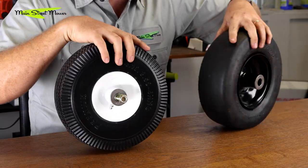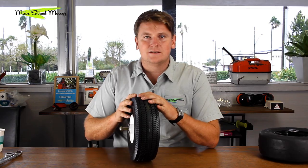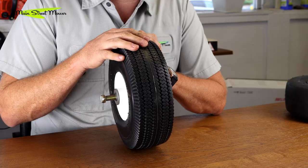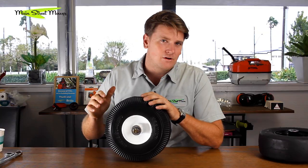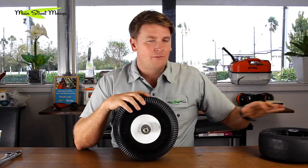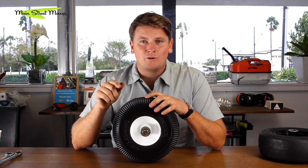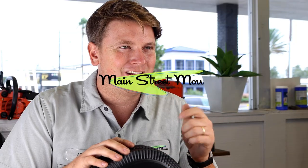You don't need treaded tires on the front — these are swivel wheels and swivels don't need tread; you want them to slide, not grab. It doesn't tear up your grass and these last a really long time. The only trade-off is it decreases your ride comfort a little bit — you'll hear a little more thunky-thunky — but it won't go flat. If you replace these on your TimeCutter you're never having a flat tire again. Please comment if you've had this problem; it helps Toro see it. Thanks for watching, please subscribe for more helpful tips.